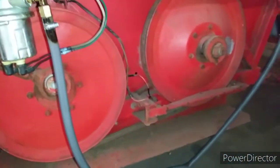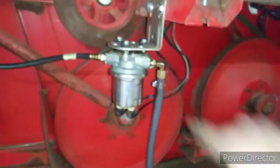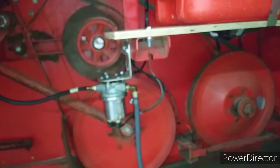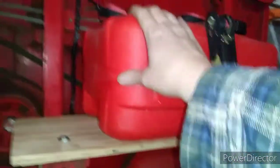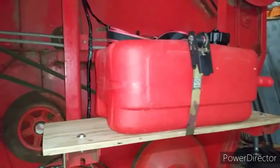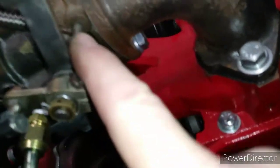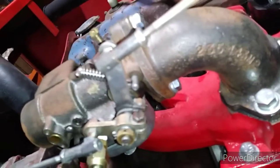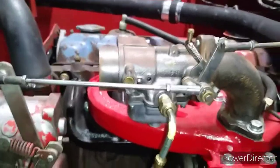Sweet success — the fitting wasn't tight enough but we've got it sealed now and it's working good. We did a test run with no fuel leaking out, gas mopped up, and the tank is secured so it can't fall off. We adjusted the throttle linkage so we should get a good idle. Up here at the upper end of the motor, when we're down at idle the screw is resting in the correct position. No fuel leaks — we're going to go give it another test run.